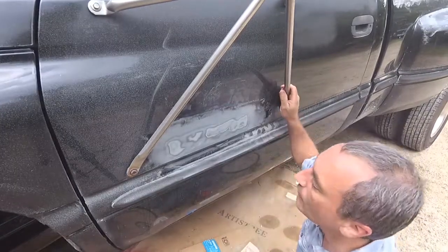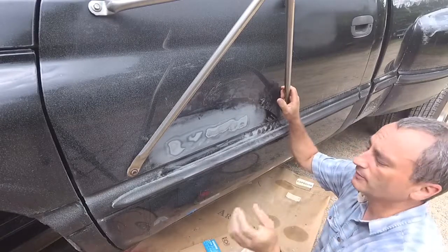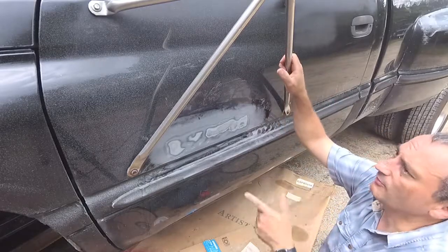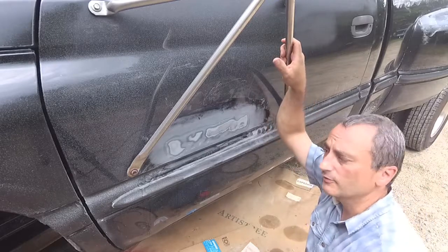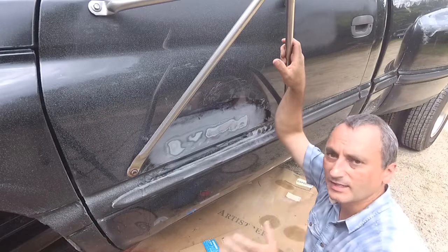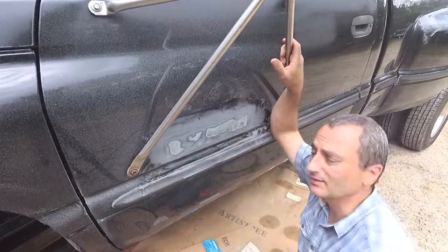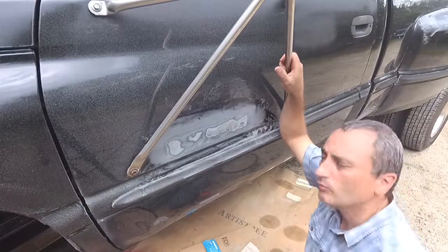There's always more than one way to skin a cat, but this is one way you can get an emblem off a truck and preserve the emblem — take it off carefully, then clean it all up and get it ready for a new coat of paint. We'll throw some primer on here just to protect this metal, because I'm not painting today. I just want to get this emblem off and get it ready, because the mirror has got to come off and a few other things as well. Now, if you're not looking to paint, then you've got to take different measures. If you're looking just to get the emblem off, clean up, and put it back, then you're going to want to use more of a chemical to get that sticky residue off so you're not damaging your paint like I've done here. But I knew I was going to paint it, so it doesn't matter. Hopefully this helps you.